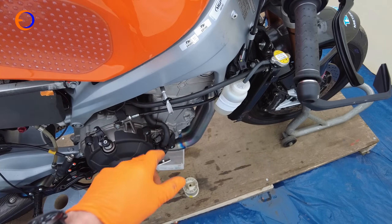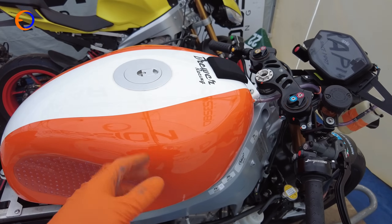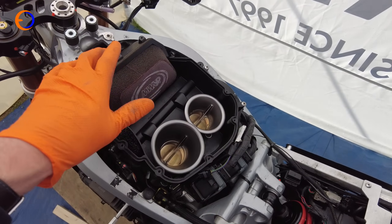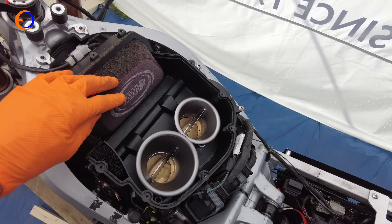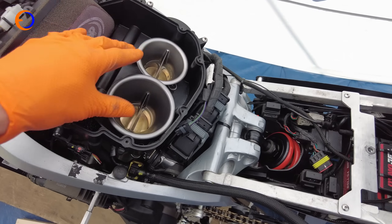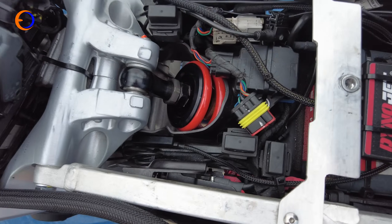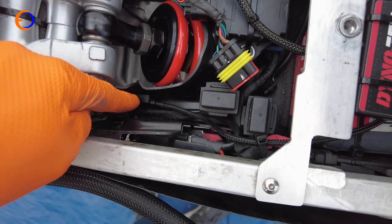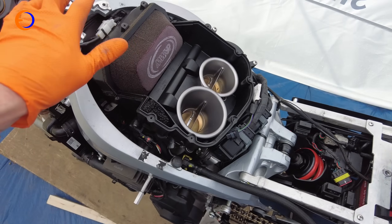Now that I'm happy with my fluid levels, the next thing is to take the fuel tank off and take the top of the airbox off, check the air filter, make sure nothing's coming loose inside the airbox, and make sure there's no big debris stuck in the air filter restricting airflow. With the tank and airbox lid off I've checked my MWR air filter — it had a couple of little bits of fluff in it which I've removed. I've double-checked the bolt security on the Jet Prime air bell mouths, and I've also double-checked the torque-check on the shock bolt. I'm going to put an extra cable tie on the HM quickshifter cabling just to have it a little bit more secure, then pop the airbox lid back on — this section of the bike is done.